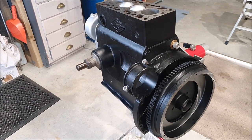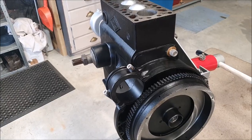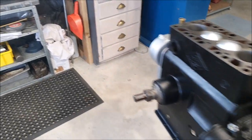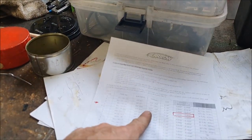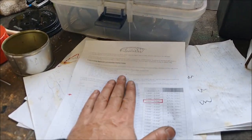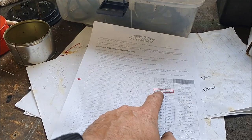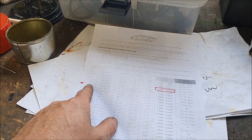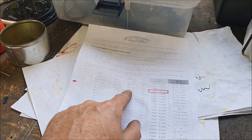The other thing I did was torque up the conrod bolts to the proper torque. These Arrow conrods use ARP bolts and the way you're supposed to set these up is via stretch, not via torque. I figured out which bolts I have — it's actually marked on the conrods — and the measurements match up.